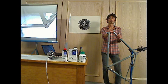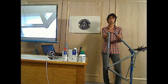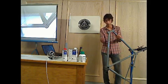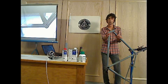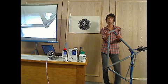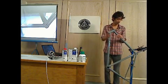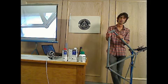So when you get your hands on a vintage steel frame, the first thing I'll do is start shoving paper towels into the head tube, the seat tube and the bottom bracket, and then take my little aerosol with the plastic tube and go in every little hole, starting with the water bottle bosses, and flood it out with an aerosol of some kind. Usually I use Boeshield T9. Great. So yeah, that's pretty much it. From there it goes to the bike shop, and then they deal with it and get it to the customer usually.